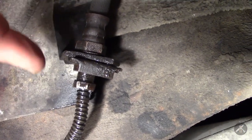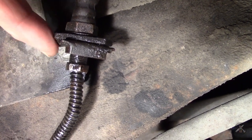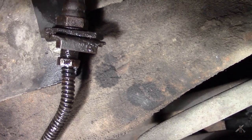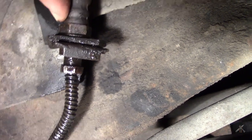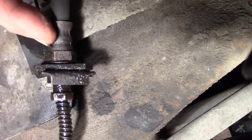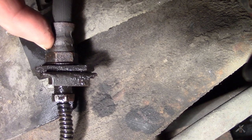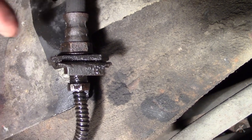There are a number of things that I did. First of all, heat right on the nut — nothing but just the nut itself, not on anything else. I put water up here; I've got a little bucket of water and a paper towel. You heat the nut, but if the water starts to boil — gets up to 200 plus degrees and starts to boil — it's time to quit so that you don't melt the hose and do bad things.